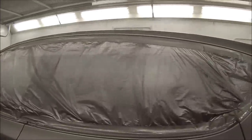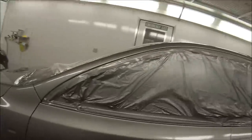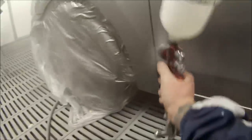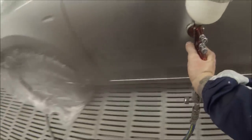As you can see, we're painting up this pillar now. I personally like to start down the bottom and work my way up on the panels that I paint. It doesn't really matter — you can start from the top and work your way down. I find it easier to watch the paint go on, and that's how I was taught when I started spray painting.